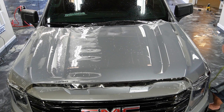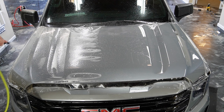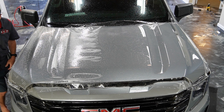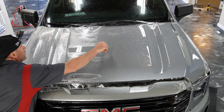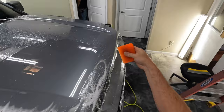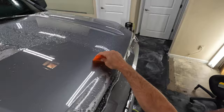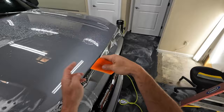The reason for that is that the part we can pull back real easy if we get some pre-tacking, but this part is going to be much more difficult if it's in here somewhere — to pull it back to get that pre-tacking out. As you can see, I'm coming across with this and I've got a lot of fingers kind of like this — that's to get good pressure. If I'm coming this way with the slip solution, I'm also going to put a little bit of an angle on the squeegee. That helps all the excess go to the bottom instead of trying to go over the top.